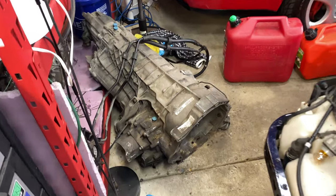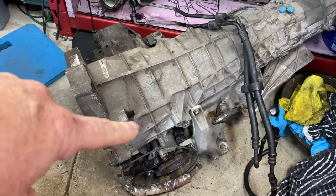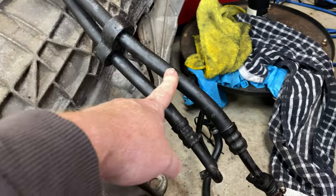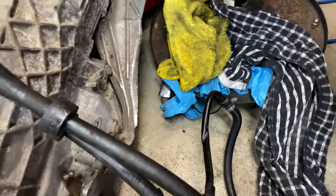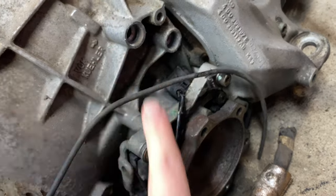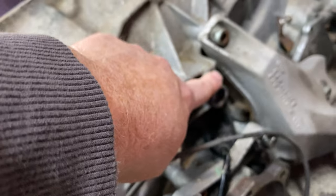The first thing we tackled — if you're familiar with the D2 S8, this is the all too familiar automatic transmission from the car. This is actually not out of my car; this is out of a parts car that I purchased to repair this car. These are the cooler and return lines that go from the transmission up to the front of the radiator. On my car during the incident, it got slightly kinked right there, which meant it wouldn't correctly fasten to the radiator any longer. If you ever have to replace these lines because they're leaking, look at the drive shaft on the driver's side — it's at about one o'clock up from that. There's one bolt that holds them on; those two flanges just sort of overlap each other and all is well.